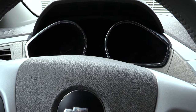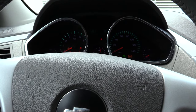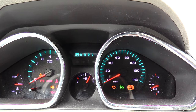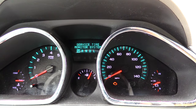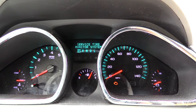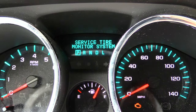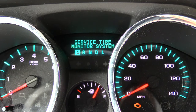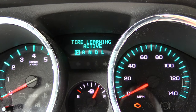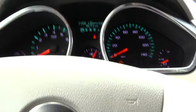On these Traverses, what you want to do is first turn your key to the ON position. Once you have the tire monitor system on, hold down your lock and unlock buttons at the same time. You should see where it says 'tire learning active' and you'll hear two honks.